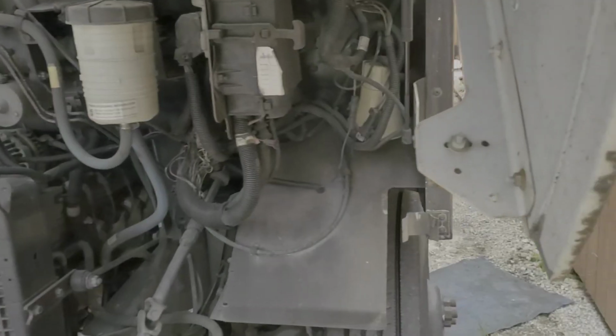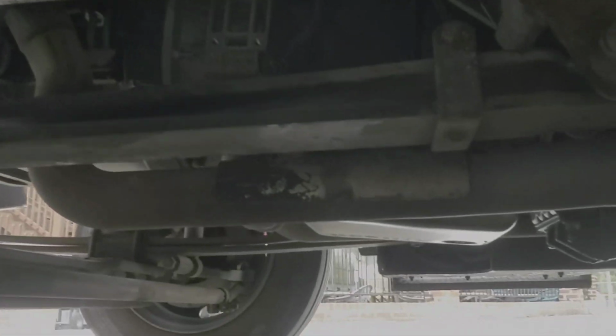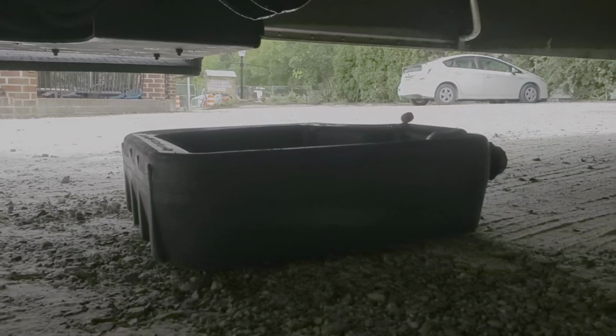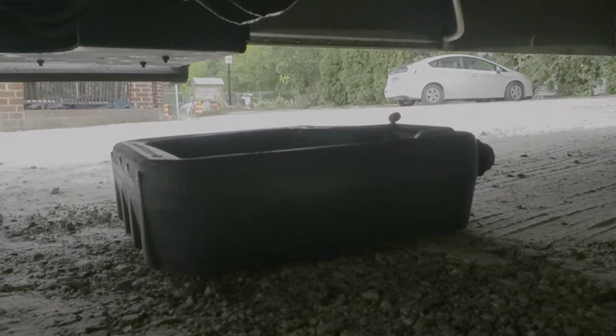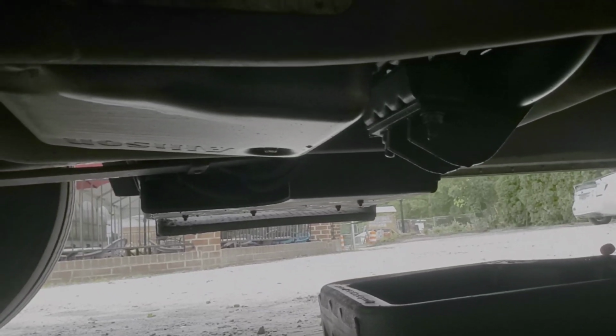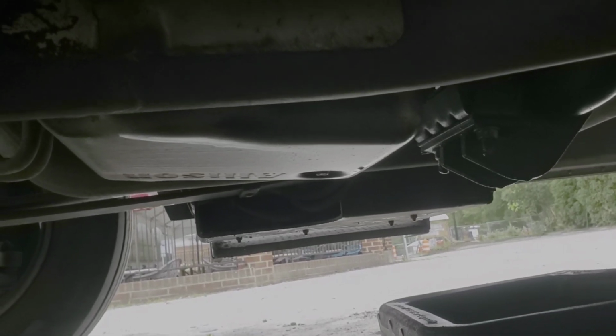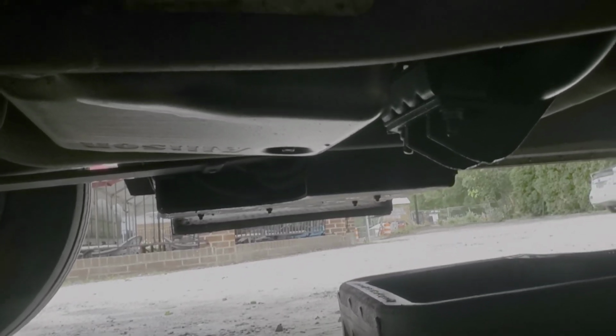Let's get into this. What you're going to need down here, of course, I'm at a restaurant, y'all, so there's a lot of noise going on here. But what you'll need down below is a drain pan, of course, that can hold, I'm going to go ahead and say at least 12 quarts. That's a 16 quart pan. But from what I gathered online, as I'm not familiar with these, it's typically 10.5 quarts that drain out. And so just make sure you have a sizable pan.